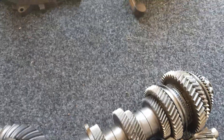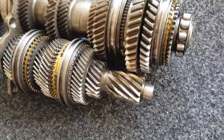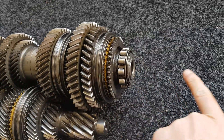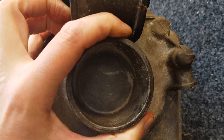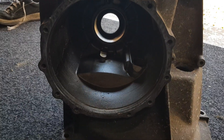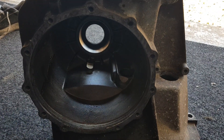So those are the basics of the G96 gearbox. This is from a Carrera 2. The same version for a Carrera 4 has an extension on the output shaft which then goes up to the front of the car for the front differential — that's the main difference. On the nose of the gearbox you'll see it's blanked off at the end, which is where the output drive would normally go up to the front differential. The differential fits in this plate here, then there's a cover plate which goes on to hold the differential in place.